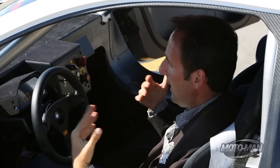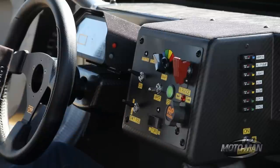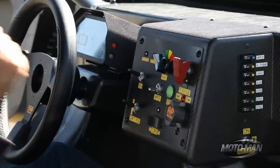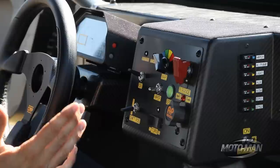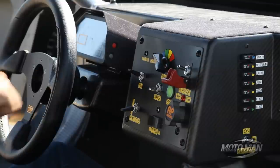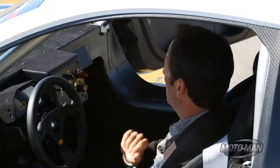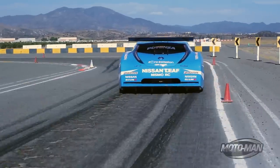The car doesn't have a transmission, so how do you go forward or backward? That's the shifter position switch. To go forward, you just move it into forward and hit the gas — or the electric — and the car will go. But going backwards is even more interesting. You go back to neutral, shift the position to reverse, and notice the car is not going to go anywhere. We have another one of these special bomb switches — you take it down and then hit the reverse range starter button. Then there's a toggle switch to pick low or high range for the reverse, and the car goes backwards. This thing really is pretty cool.